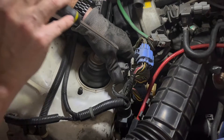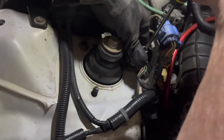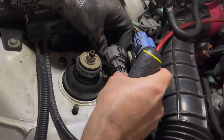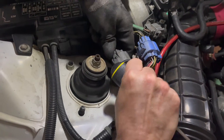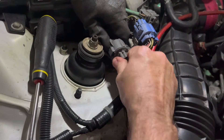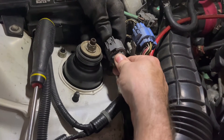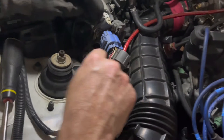On the passenger side, notice this electrical connection right here — it's right over that bolt we need to get to. We're going to have to get that connector out. What we're going to do is push this tab, get a screwdriver in there, and it's going to slide straight up, then we'll slide it back on to make it click. These old connector parts are not nice. Now we can see the bolt.